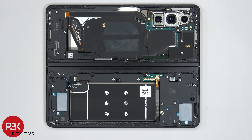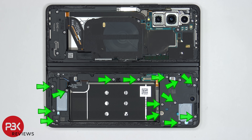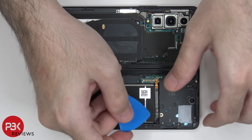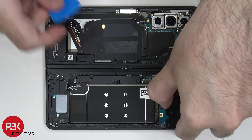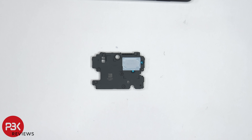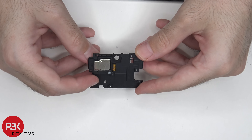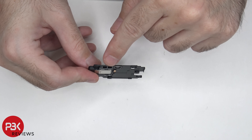On the right portion of the phone, or the side where the outer screen is, there are 14 Phillips screws which need to be removed. Once the screws are removed, we can lift up and remove the top cover. This top cover also has one of the speakers. There are also two portions of the speaker housing which have white foam balls, and on the other side we can see the speaker itself and the opening for the speaker on top.